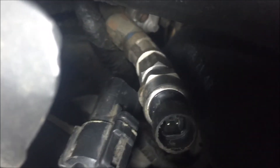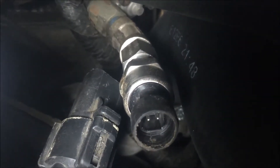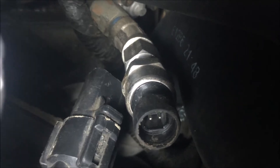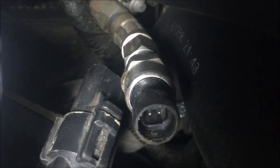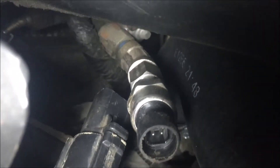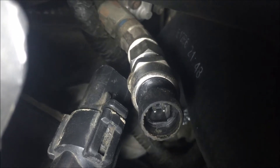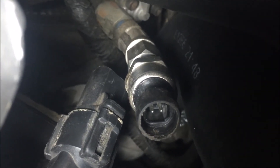I have a few fittings in there. They're all stainless steel just to make sure they're not going to corrode — you don't have to go stainless steel obviously. That's the 0 to 100 PSI sensor there. Your nominal operating pressure is going to be about 65 to 70 PSI at most as long as you have a stock pump and stock system. Maybe with the upgraded blue spring kit you can still run that pressure; with stock pressure you'll probably still be 55 PSI or so.